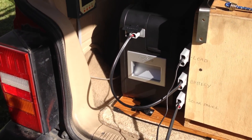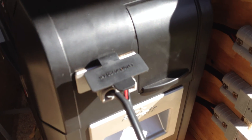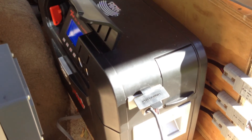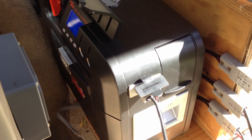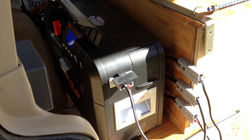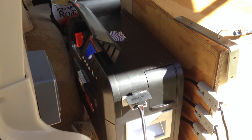The battery box is mounted down with these brackets — there's one on the other side. You undo that screw, that slides back, take your battery cable off and your terminal's on the other side, and that all comes out. So that can continue to charge, run the fridges, run the lights — all our lights are LED strip lights and portable LED lights. And that can sit outside the car and continue to do its thing while we take the car for a drive or whatever we want to do.